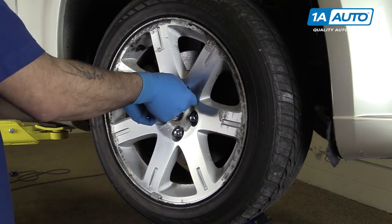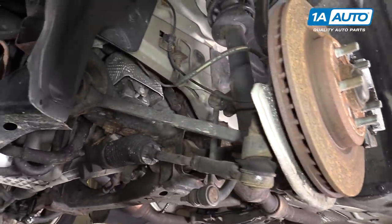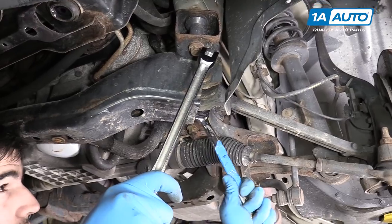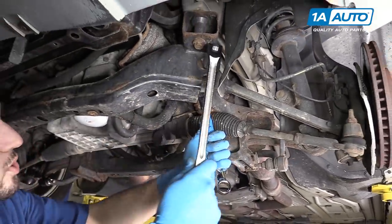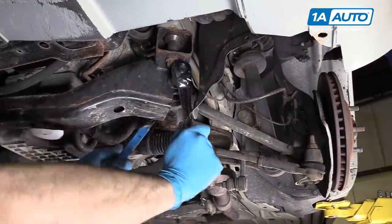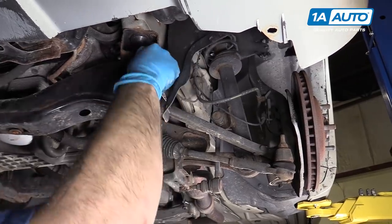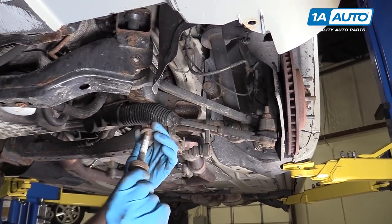Remove your lug nuts the rest of the way by hand, then remove your wheel and tire. After removing your wheel and tire, locate the bolt for the forward lower control arm on the subframe. To remove this, we'll use an 18-millimeter socket and breaker bar, as well as an open-ended 21-millimeter wrench on the nut at the back. Make sure that's on there good and tight because you have much fewer points of contact with the wrench — you don't want to risk stripping it. Once you get it loose, you should be able to switch over to a socket and ratchet. Finish removing the nut and bolt by hand. Be sure not to lose these large washers that are on either side of the subframe. Place those somewhere safe while you finish removing the forward lower control arm.